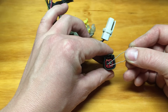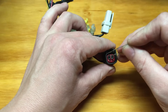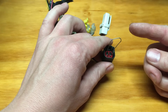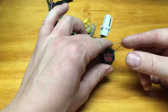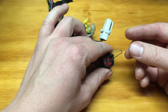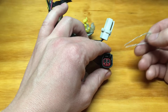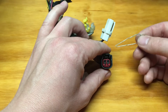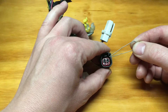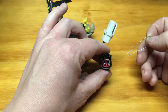By doing this we're taking that ground and jumpering it to the controlling module. If your lights are on inside right now and we jumper these two terminals, your dome lamp should start to dim out — some vehicles need about 30 seconds. Once it dims and realizes the door is closed, pull it out, and with your key on the thing should start beeping. Your dome light will come back on, and right there you've diagnosed the controlling module, the ground coming in, and the circuitry back to those modules.